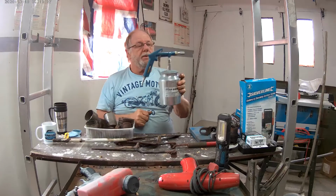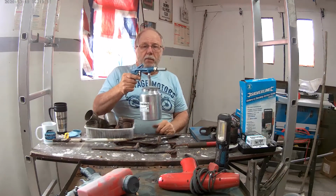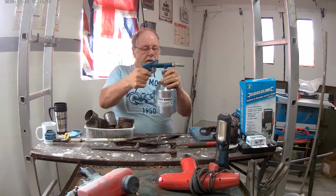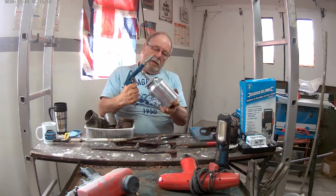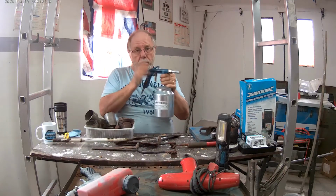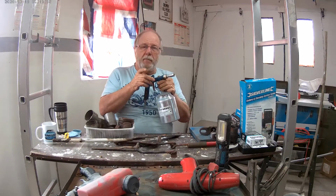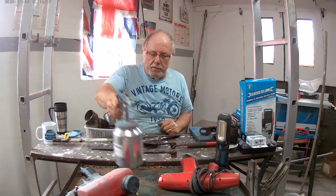I did mention this. I've got a cabinet outside, man-made, I bought off a guy at Lincoln. This is the Work Zone sandblaster. You connect it to the airline, you fill it up, and away you go. Good tool. You want high pressure, you want more than an 11 bar compressor, really. But it still does the job at lower pressure.